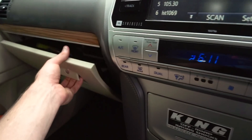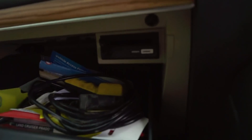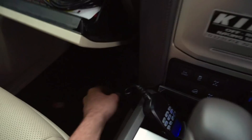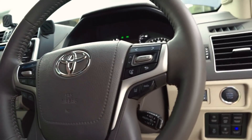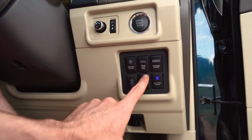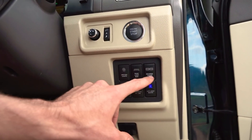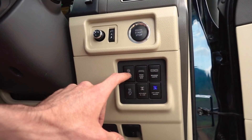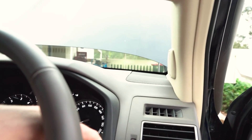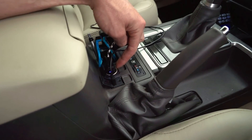My UHF is mounted in there, slings in and through, out the bottom — seems to work quite well. Also running from the front is the torque converter lockup kit. Here are my two switches: master on/off and high/low speed. I've also got a few spare switches for future use — reverse lights, roof light bar, and driving lights. The driving lights are set up and very bright. I'm going to convert this to auxiliary power.